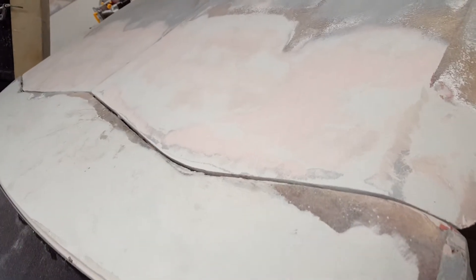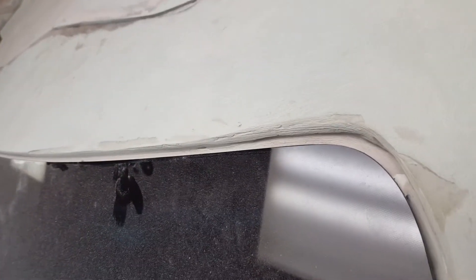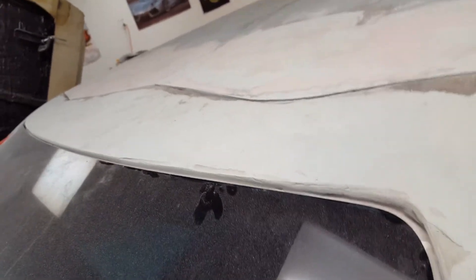The body people have to really clean up all the gaps. The windshield spacing — you can see it's a little bit low on this side compared to the other. I think that's about right — maybe the size of a pencil or a little less. Then you're just going to have rubber sealer in there — RTV or windshield sealer — no molding or anything. That's the look I wanted.